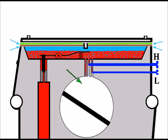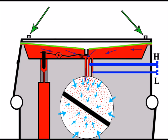If you do suspect this is happening, then the remedy is quite simple, providing the gasket and the diaphragm are okay. Just make sure these screws are nice and tight. Not too tight, as that we can strain the threads, but nice and tight. You'll soon know if it's a problem up here because you'll see fuel leaking down. So you can always try tightening these screws.